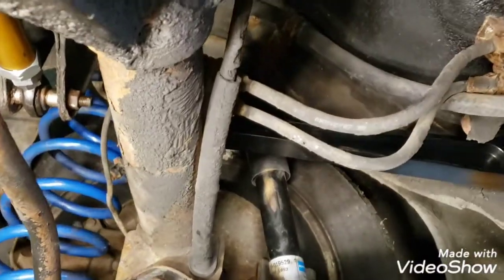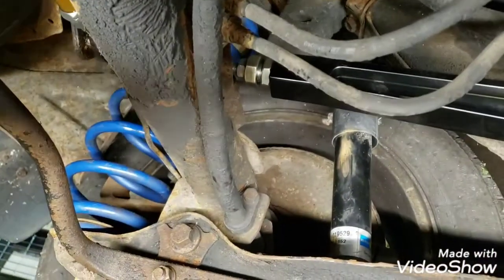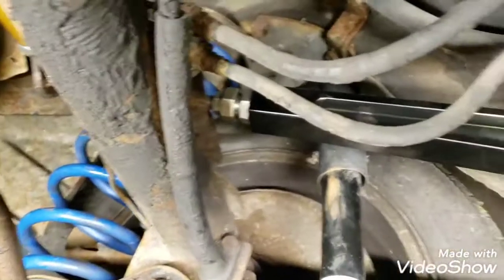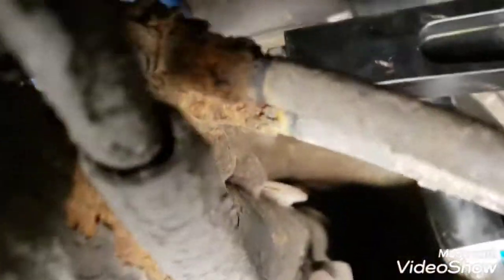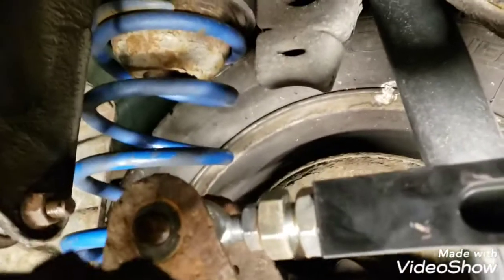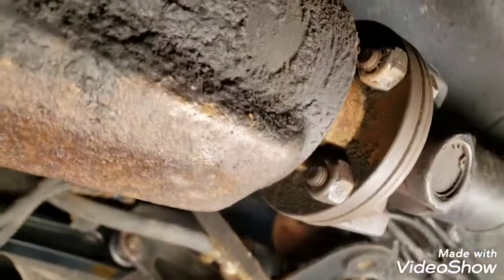So you'll use these adjustable end links here. These end links up here, and you're going to want to just shrink them up about a half a moon distance in that bolt hole. Like, lay this bar out to a stock length bar, and then put it up in here and shrink this end down so that you see about a half a moon in that bolt hole there. And get a better shot up there. Yeah, about half of that bolt hole you want to go back towards the transmission and roll the axle forward, and that'll square up this flange.